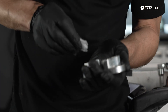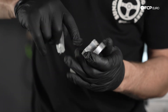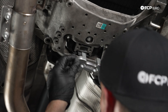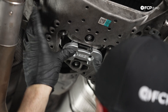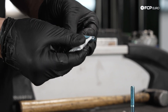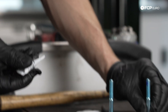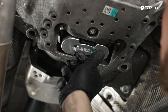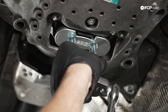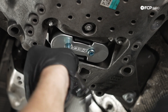With a little bit of PowerFlex polyurethane bushing grease, which is waterproof — any waterproof grease will essentially work — grease the surrounding area that is going to be installed into the mount, then push that in. It will go either way, so go ahead and install that. In the kit from 034, we do have a dash of blue Loctite to ensure that these new fasteners do not come out. Put a little bit on the threads — you don't have to go crazy, it's just to help keep it in place. Install these into our new insert, making sure they catch the threads before starting to snug them both up. Torque these 6-millimeter Allens with the blue Loctite to 30 Newton meters.